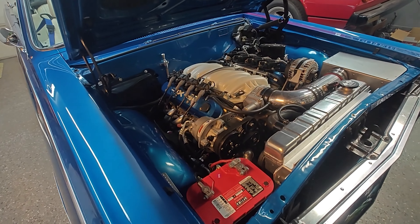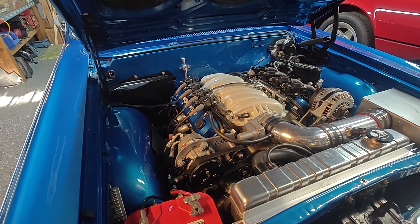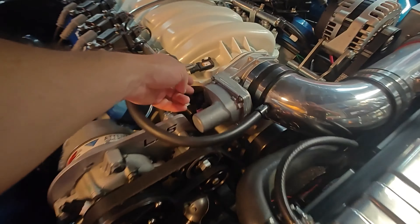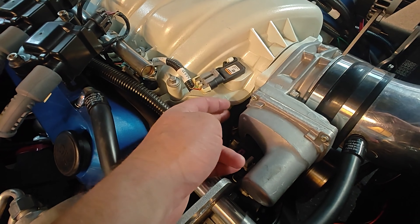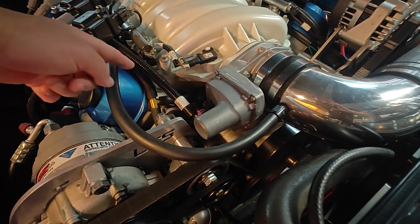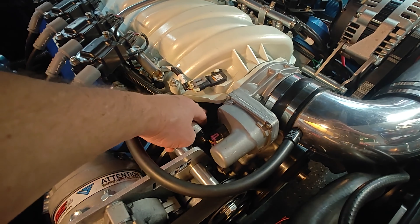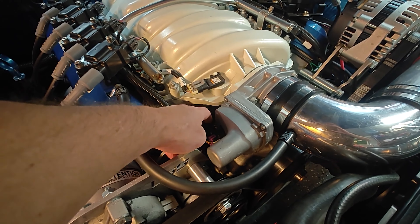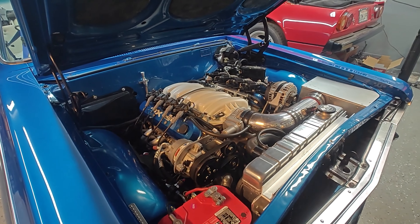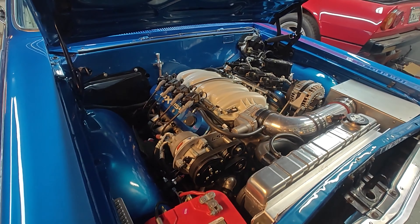So what is my problem? We came to the conclusion that this thing is literally vacuuming the oil out of the engine, probably from that catch canister. The line at the intake manifold is causing a vacuum, which is pulling oil backwards through the system, through the valve covers and the lifter valley — this valley cover at the top of the engine.